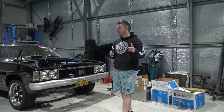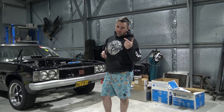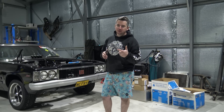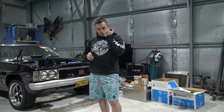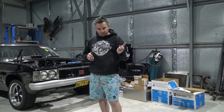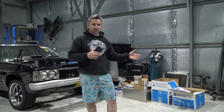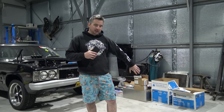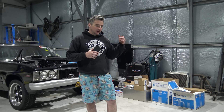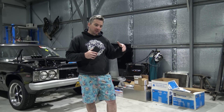I'm going to have two dry stages of nitrous. I'll probably set up one stage to use with methanol — I know nitrous and methanol, a lot of guys don't, but there's a lot of tunes out there for that. I'd like maybe a 200 horsepower shot if the pump will do it, just for events like Power Cruise. If I want to do off-street or track racing, I can use methanol with one stage of nitrous, but I want to have two stages available.